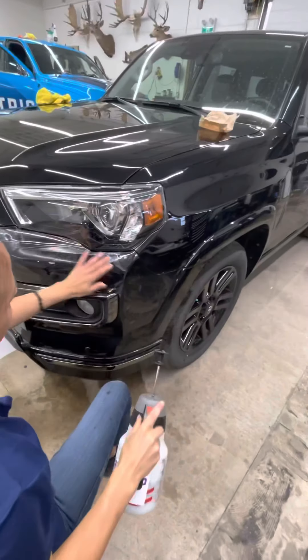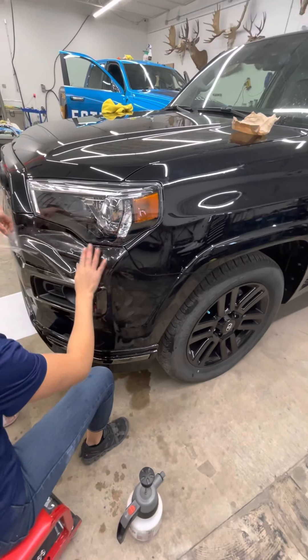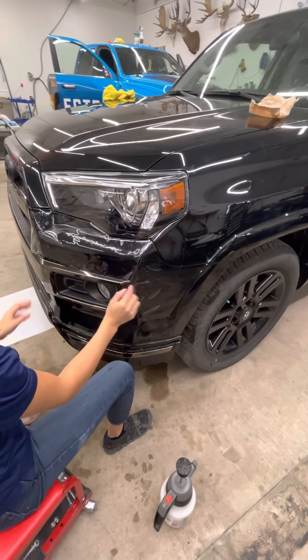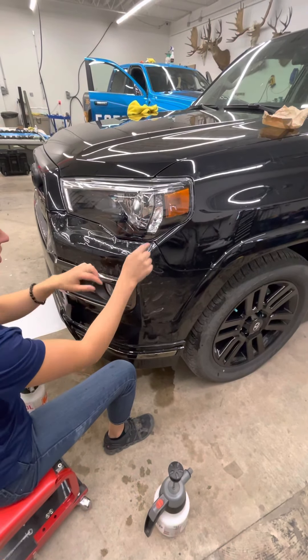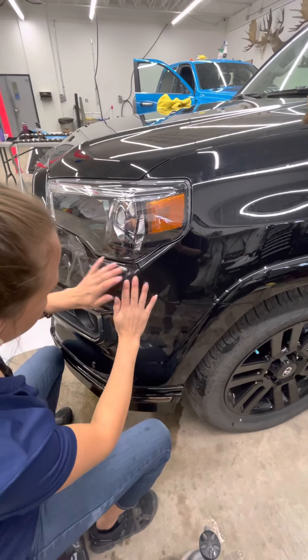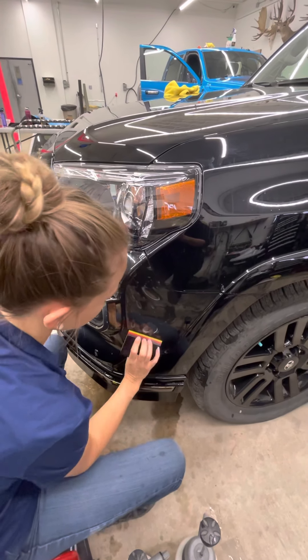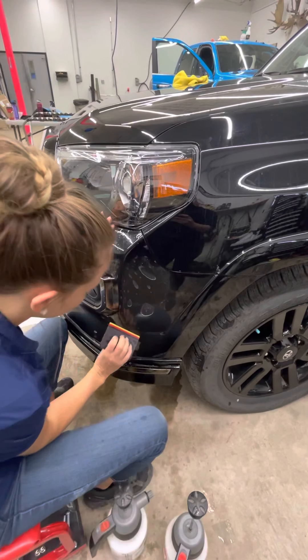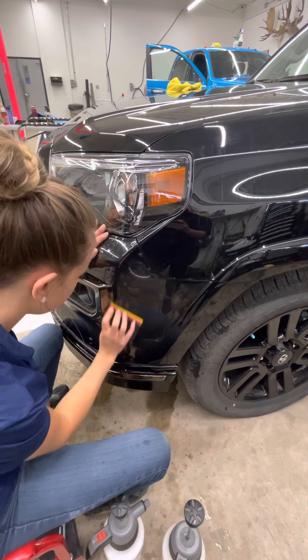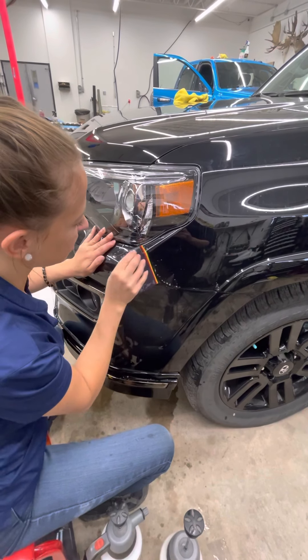So now we do the top. Spray this with soapy water again — you're always going to lift it up and spray where you haven't done yet, making sure it's going to move around for you. Our next tack points are right here and right here, so we want to make sure it's coming around there but not coming too short here or too short up there either. It's better to be a little bit long because we can always trim that off. I'm actually going to curve that piece first, but at the same time making sure this is laying down too. I'm pushing in that direction to create it going around this hump and laying as flat as possible. Lock that corner in — we're a little bit long here so it's probably not going to lay down completely until I trim that.